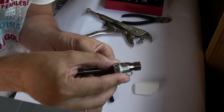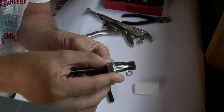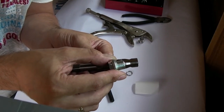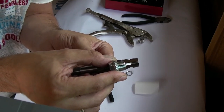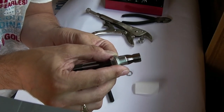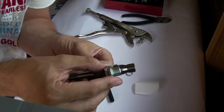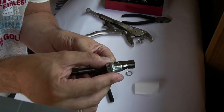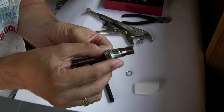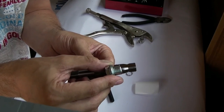Now then, this is where you need to be careful depending on the engine you're doing. I've looked at the schematics, and according to the Hayabusa diagram, there is nothing worth worrying about. Nothing anywhere near this coming through into the sump, into the oil pan area. It's absolutely clear. Now, I trust the diagram, but not 100%. So what I'm going to do is check that what I'm doing is right and I don't damage anything or start hitting up against anything inside the engine.